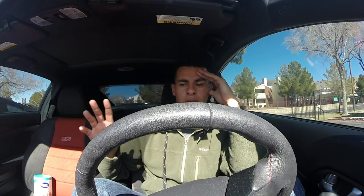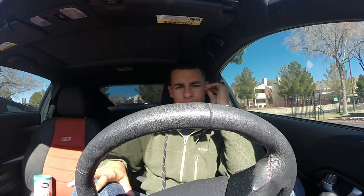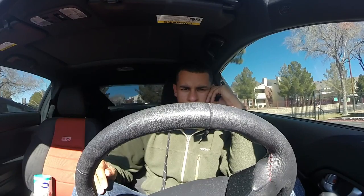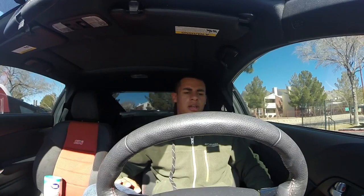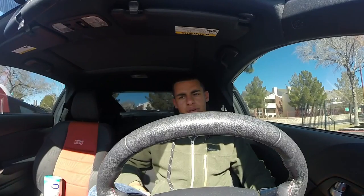At the same time as all that, I'm also looking into getting a NIS tune. Main purpose behind that is to get a reliable tune on the car, and to get a method really of going through and being able to measure out exactly what's wrong with the car. That way I can actually read codes, because as I'm sure other 240 owners, well specifically SR owners that are still running with the stock ECU know, there's no OBD2 sensor. You're still running on OBD1, and it's really annoying to try to get your codes from a little flashing light.